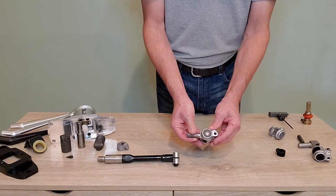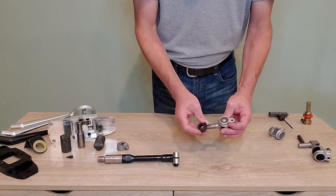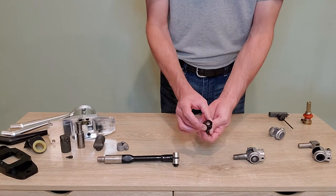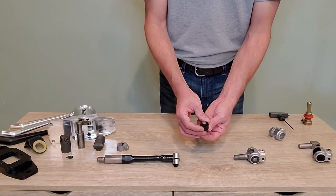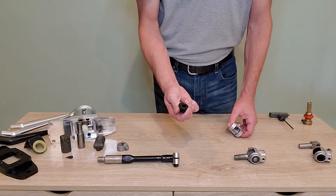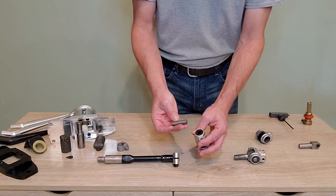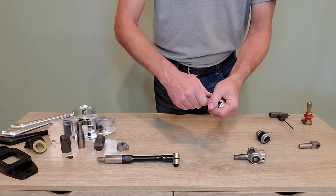So if we don't like the shift couplers with the slot in them, what are we to do? These are the aftermarket bushings that I sell — available from lots of sources now. Some people have checked these out, put the rod in there, and said 'these are junk — there's all this slop.' Well, these are actually a somewhat soft urethane material. When you put the bushing inside the coupler and squish it down, it actually makes the hole smaller. Here's the same bushing installed inside the coupler — you can see it's a very tight fit. It works out fine once the whole thing is actually assembled.